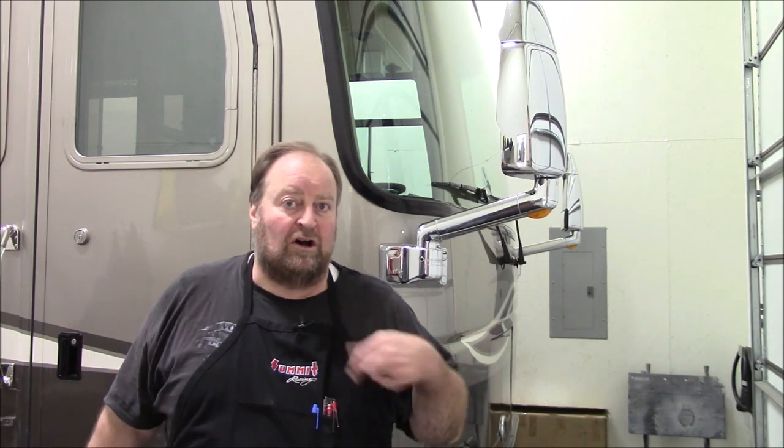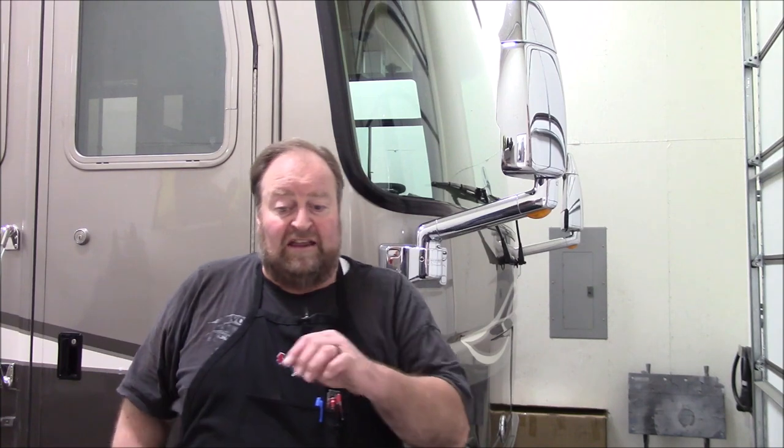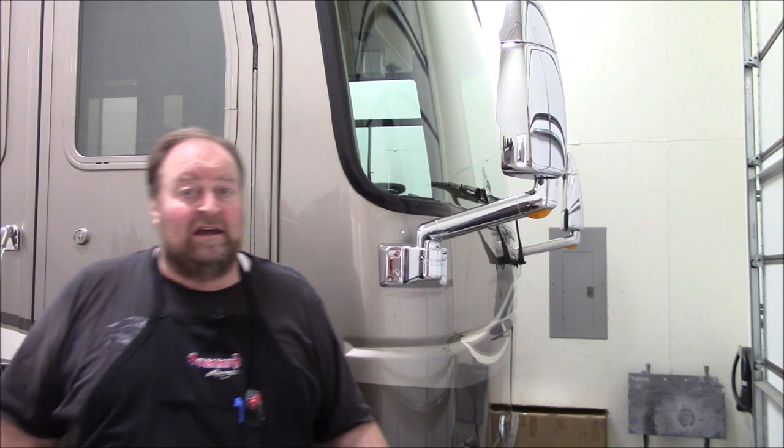I'm going about it a little differently than just pulling the old one off and screwing the new one on. I'm actually going to build a picture frame out of one and three-quarter inch wide by three-sixteenths 6061 aluminum, welding the perimeter. That will sandwich the lexan and the inner bubble down to the roof. My theory is that the screw heads create too much pressure at each individual point — with a framework it'll put more even pressure down rather than just pressure at the screw heads.